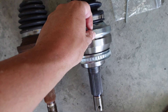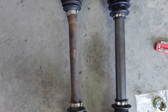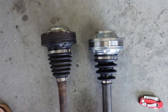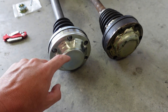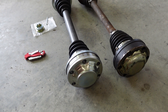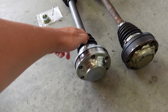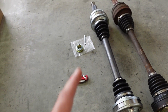This looks like it's almost anodized or has some type of zinc coating on it. One thing you'll notice is these are lined up but one is shorter than the other, so it looks like these are slightly undercut. We'll find out if it's going to be an issue — these are $75 for the entire axle with everything. The other thing I noticed is the caps are different: this one is more rounded off versus this one being more squared off like a snub nose. I don't know if that's going to cause issues yet. The splines are correct, but the biggest thing I noticed is it seems a bit undercut, which puts more tension on the CV area. I talked to Alex — he uses these and said he's never had a problem. So let's throw this one in and see if it fits.